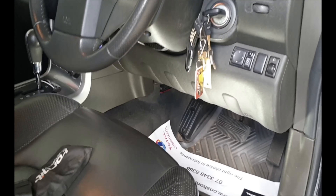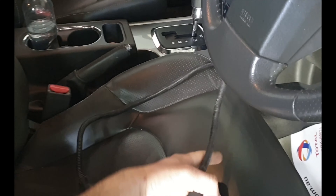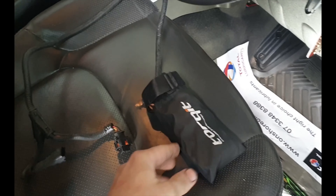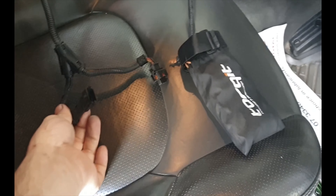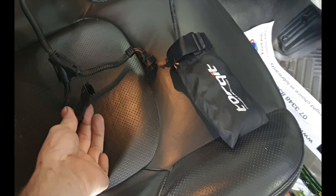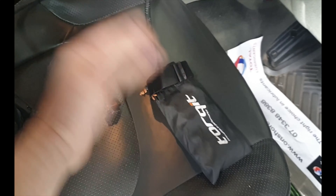I'm not happy with that chip. As part of the diagnostic process, basically what we told him is: we need to get rid of these before we're even going to attempt to diagnose this. So I just removed this other chip that he had in the engine bay. This one essentially is just taking the rail pressure from the rail pressure sensor, modifying it by going through this unit before it then sends it off to the ECU. We are getting quite a few problems with them, and I'm not here to name and shame brands — I've taken them off cars because of the intermittent issues they've been causing.